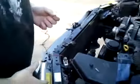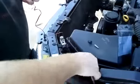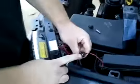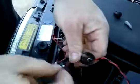On my car it's fairly easy — I don't have to splice any wires. There's already what they call a city light, which has a plug for it. I've already got halos wired into my car, so it's even easier for me. Since these wires are so thin, I cut enough room so I can double up on the wire to make it a little bit thicker.